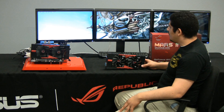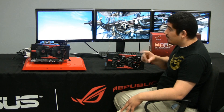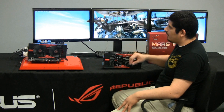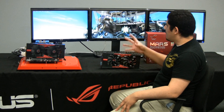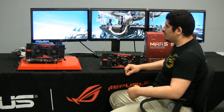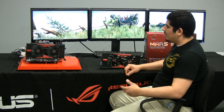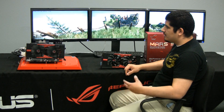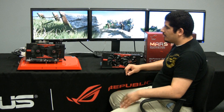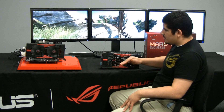At idle, it's generally going to be running sub 22dB. You can see here where we're running a very high workload — not just one monitor, but three monitors. We're running native 3D Vision Surround at maxed-out settings in Unigine Heaven 2.5, DX11, tessellation enabled, all those good image quality and eye candy features turned on. You can see the card is overall quite quiet, and we're running those full GTX 580 cores at full default clock.